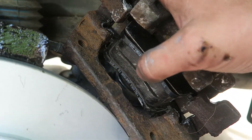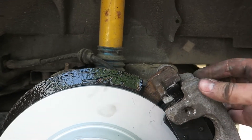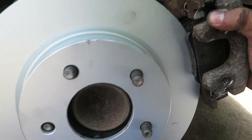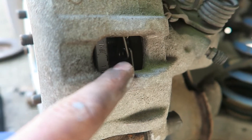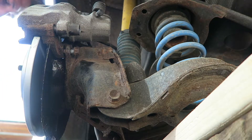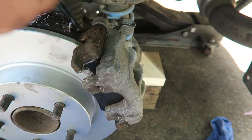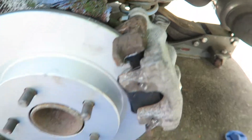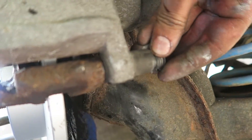I think I have to shave it down a little bit. When you put the new pads in, you have to go in and then push it to whichever side it goes to — the one with that butterfly pin goes in the inner. Just gently push it back into place. Here you can see that butterfly pin is on the inner pad. Now this is sitting on the rotor. We just have to put those two bolts back in to the caliper. Now that we got those started, just tighten them up with your 9/16ths. Now that we tightened up those two bolts and tightened up these pins, we just need to put the new caps on.